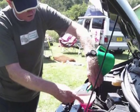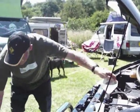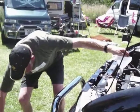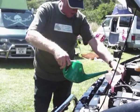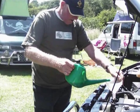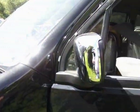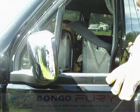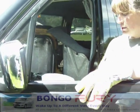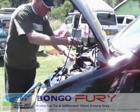The Bongo system holds 13 litres altogether. But as we've only changed the hose, we've probably only lost a proportion of that. So you just keep filling until it overflows out of the radiator. We're getting near the top — Kirsty's holding the funnel inside and eventually the coolant will start working its way up the bleed pipe and into the funnel. You can just see the level starting to come in with a few air bubbles. We can see bubbles coming out of the radiator and it's full. So we put the cap back on the radiator.